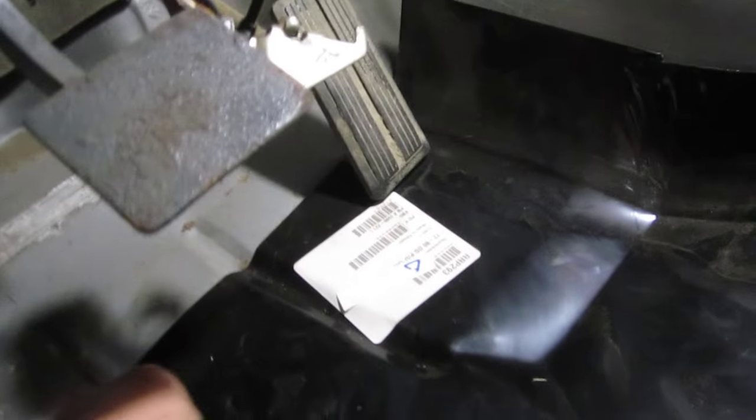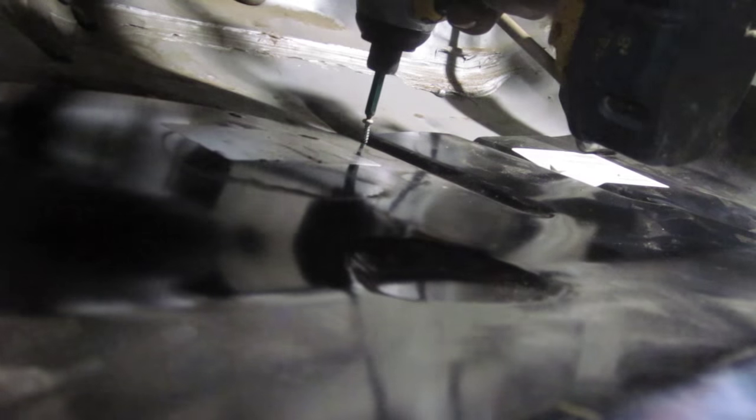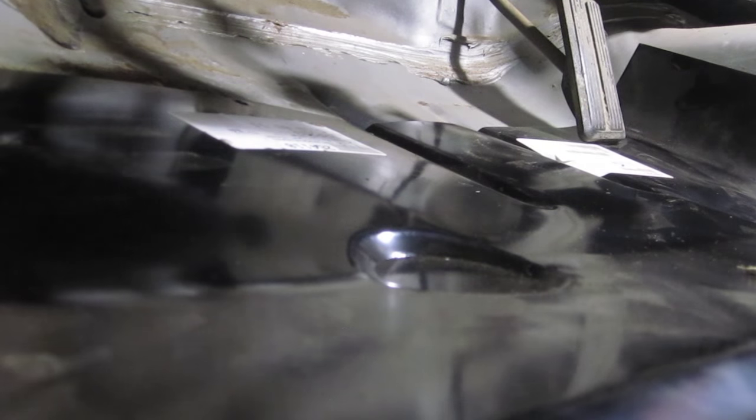I got the other floor cut out and it fits a lot tighter now — not 100% yet, there are little gaps here and there from imperfections. What I've done before is used soffit screws — just screw it down so the floor doesn't move. You can make your line perfectly with just a couple of them; not too many, because you've got to fill those holes in afterwards and that's more grinding. We've got another little gap here that might need a little persuasion with a two-by-four to bend it down, then put a self-tapper in.